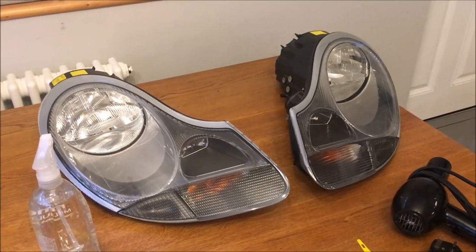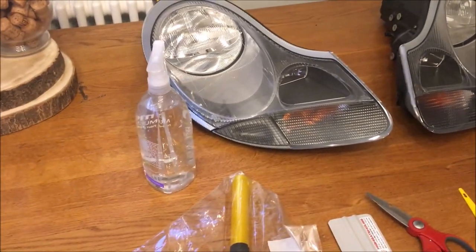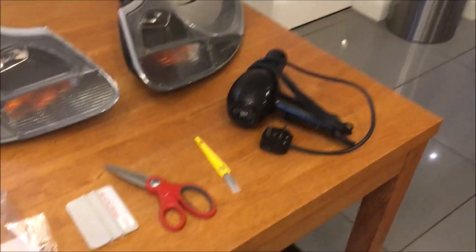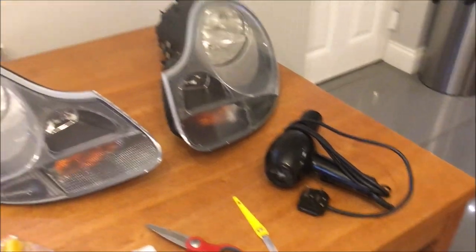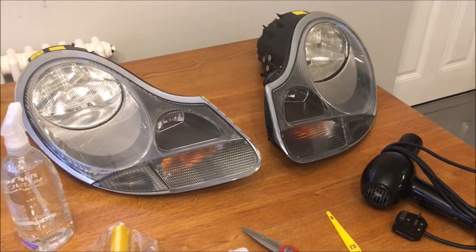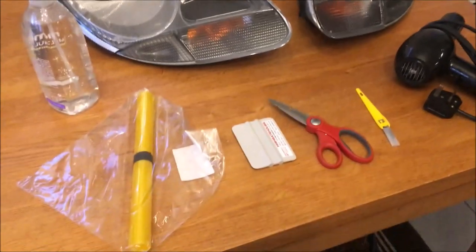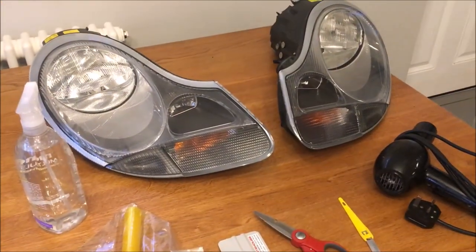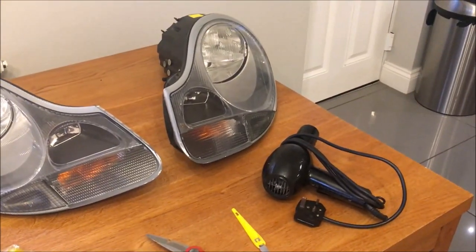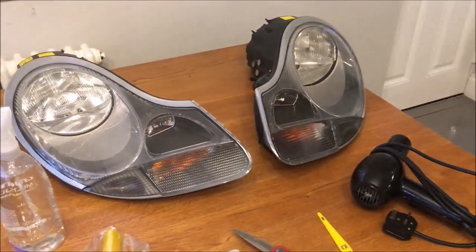Got the headlights inside and now it's time to get busy. All you need is some very nicely clean headlights — make sure you clean them up first. You'll also need a spray bottle of water, your tint film, a squeegee, some scissors, a knife, and a hairdryer to help you heat it up and mould it. Spray the water onto the lens to give a little lubrication for the film to be moved around. Squeegee the water out, use the hairdryer to heat it up and make all the contours, then trim around the edges. Let's see how we get on.